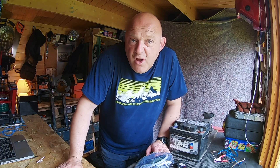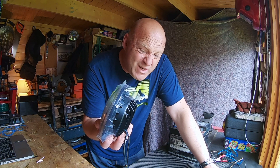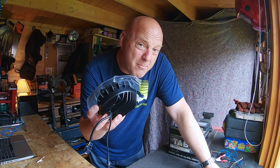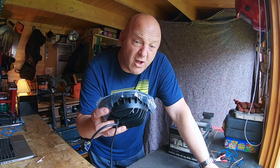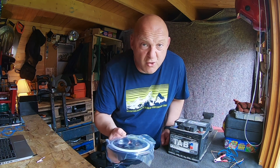So it's SAE and DOT approved, and also CE approved. 40-watt rated high beam and 30-watt rated low beam. It has a voltage rating of 9 to 32 volts, which is perfectly within the range of motorcycles. Lumens rating is 4,800 on high beam and 3,000 lumens on low beam. It's a 7-inch diameter light with a built-in internal fan, low voltage protection, and an integrated cooling system with fins. Lifespan is supposedly above 50,000 hours. It's also rated waterproof to IP68, and is rustproof and shockproof.